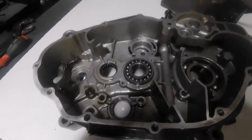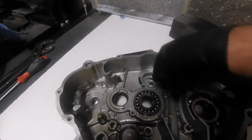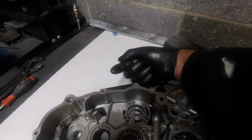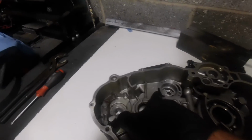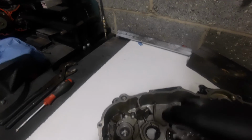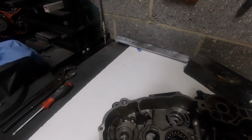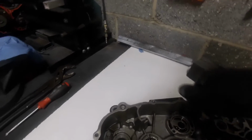Take it as read that the oil has now come into this side of this chamber, because our main, we're going to call it our main, our scavenge pump has now fed into that at the back that we were talking about, and it's now going to come out here. So what happens there is it comes out of there, now pressurised. What normally would come out of there is just the oil up the pipe and into the pump from the tank, but we've now got a situation where the scavenge pump is feeding that. Hope you're with me with this. But again, our plate now seals up our scavenge pump and keeps it in play in there.